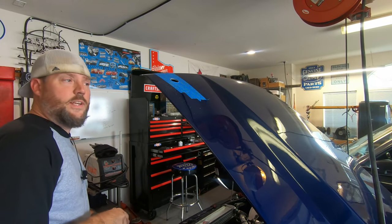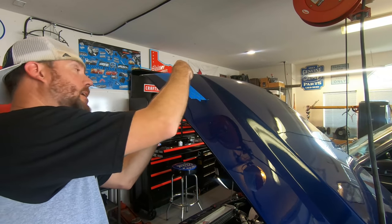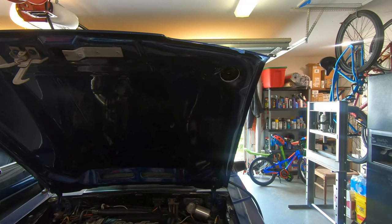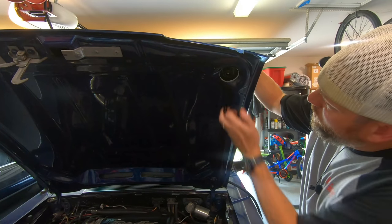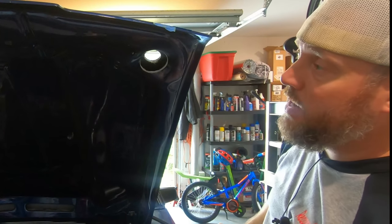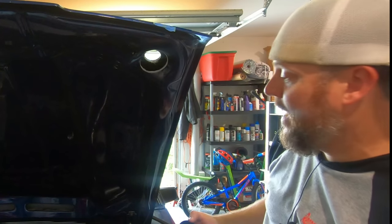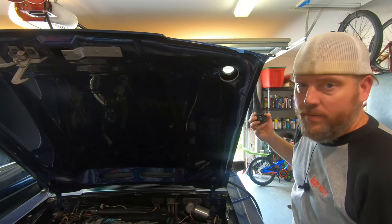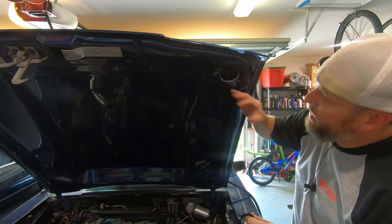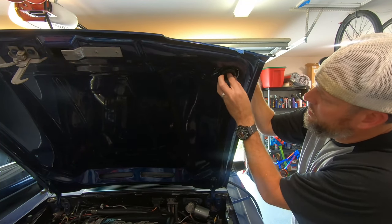That makes a nice clean cut — making sure I went all the way through. Now taking the smaller one-and-a-half inch hole saw and cutting through the top layer. Test fitting it — just like that. On the back side there's perfect clearance for the ring. A word of caution: with this quick latch style, the ring screws in from inside, and it is super easy to accidentally drop the ring into the bowels of your cowl hood. You'd have to pull the hood off to fish it out, so be careful.